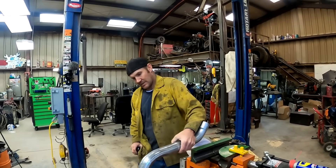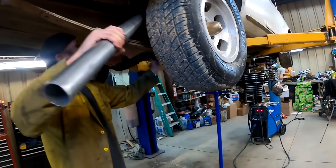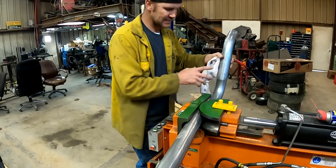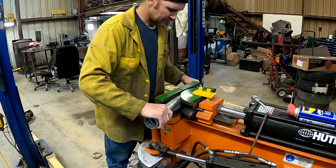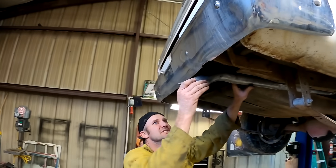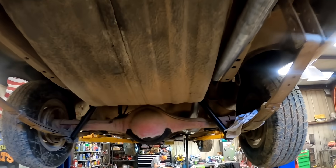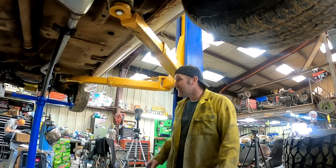We'll see what that appears like — want to come up right here, come back along the gas tank, another piece right out, kick her down right at the old exhaust pipe. We'll cut that off right there on that angle — probably right there, that'll be just wonderful, that'll be the tailpipe. One done, one length and a little bit to do on one side, so now all I gotta do is repeat that side and then exhaust is done.